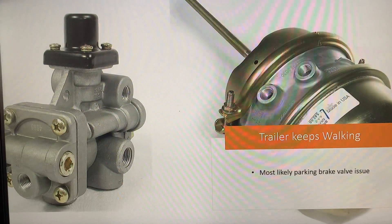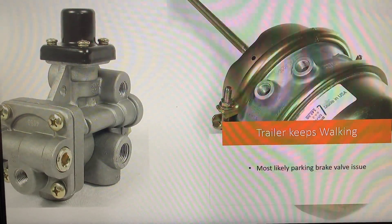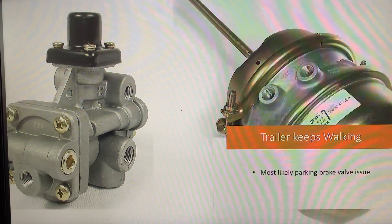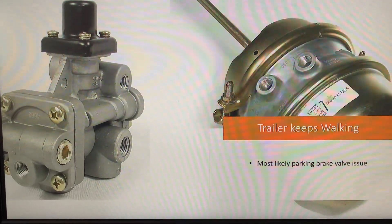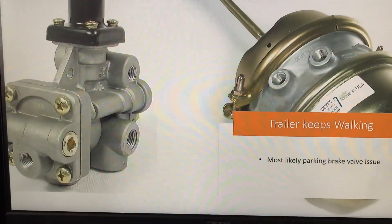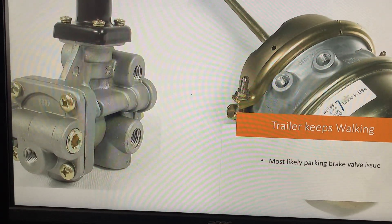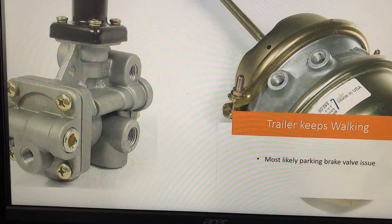You could try to adjust the brake chambers — I tried that multiple times. But if you do it too often on a newer trailer, those are auto-adjusting slack adjusters, and it could damage the internal mechanism. New slack adjusters are auto-adjusting, so you don't want to do it too much, otherwise you will damage the internal mechanism.